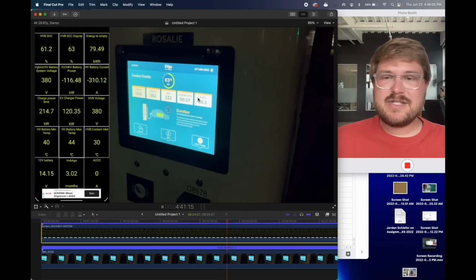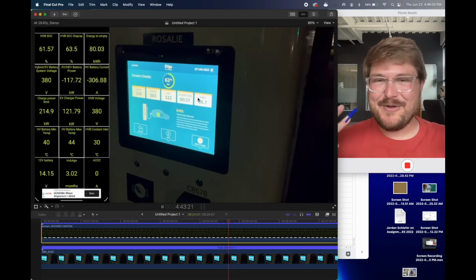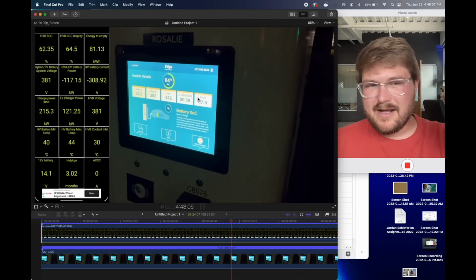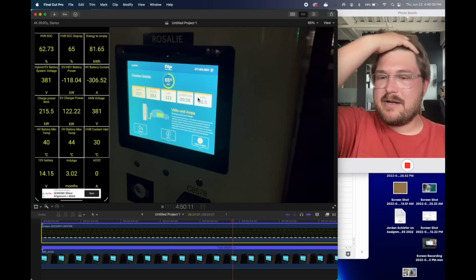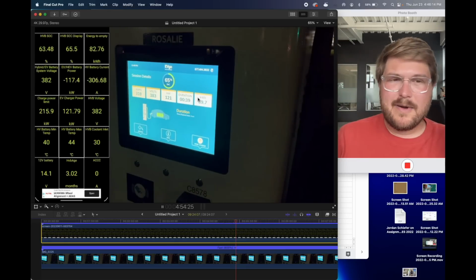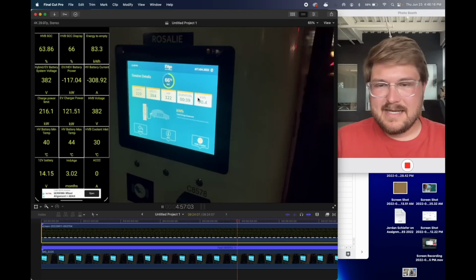So I would recommend, sure, if it's easy for you just to pull in as low as possible, pull an out of spec move, go for it. But I think the real thing here is to work the top end of the battery pack, where you're charging till you hit this 120 kilowatt ledge around that 40-50%, and then maybe head to the next station.